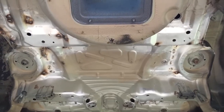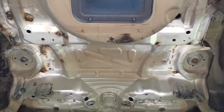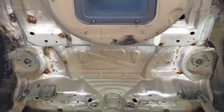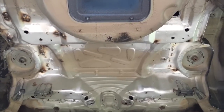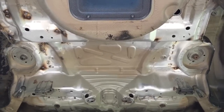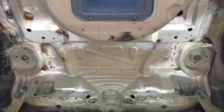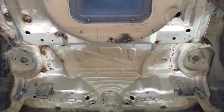So with the initial assessment and then the strip down of the underneath, the interior strip out and store, and the full degrease, and then all this crack repair work and identification work and seam sealer, sound pad removal, and all the extra work inside the cabin, we're up to about 20 hours now on this particular vehicle. Each vehicle's different, some don't need the inside work, but this particular one we're at about 20 hours, and that's not over the course of a week or something. That is 20 hours not non-stop because we have to go home and sleep, but you know what I mean, that is 20 hours added up for the process for one person. So just put that into perspective, even before the reinforcement plates start.